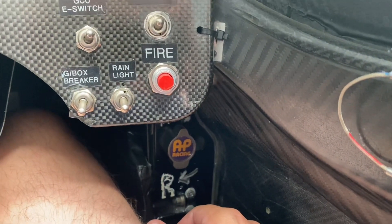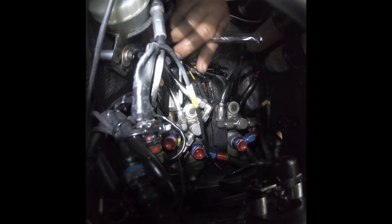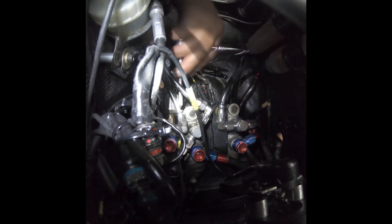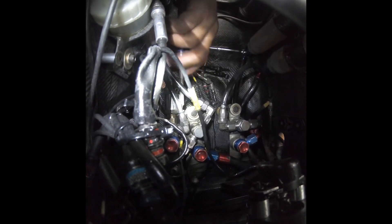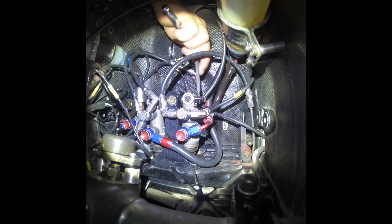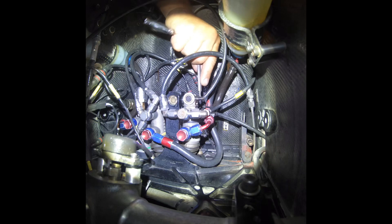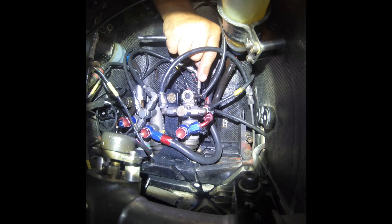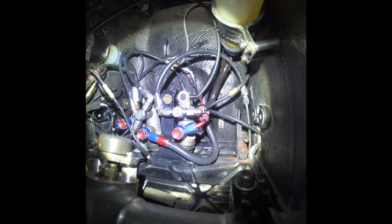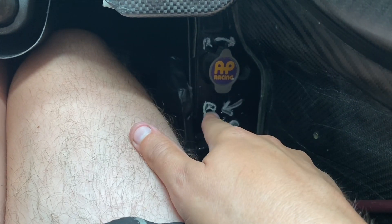We found that it was actually getting stuck on the clutch cylinder and wasn't making any adjustments. The cable was actually getting quite wound up down in the footwell, which obviously you can't see, but we took some earlier videos. We were able to fix that by moving the cable from one side to the other, which made the adjustment work the opposite way around, so we had to relearn which way was to the rear and which way to the front.